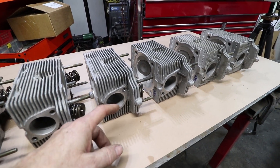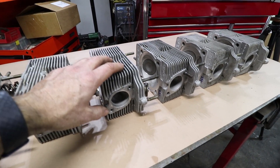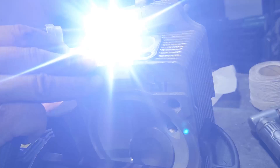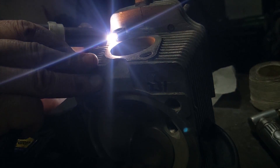I tried to work the original stud as much as possible. I even tried the washer method, where if it's broken off right at the head you can weld a washer onto it and then weld the nut onto that. That puts a lot of heat into the stud and tries to break free the bond.